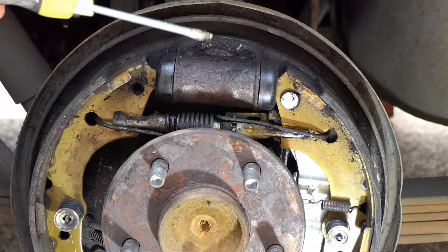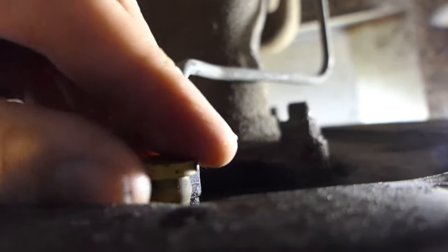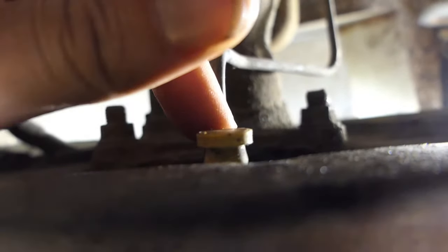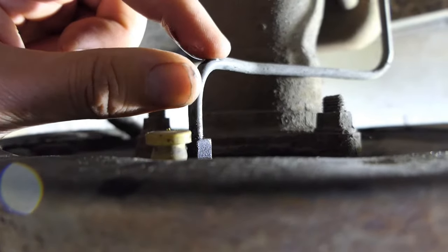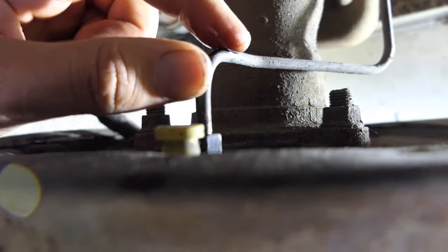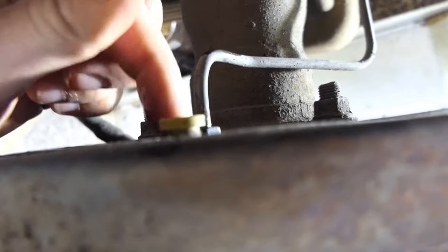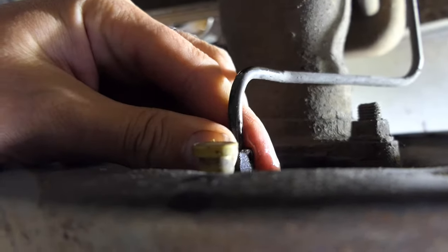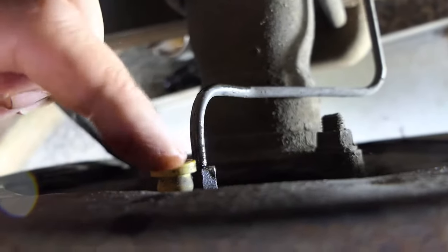Or get a ring spanner and you can cut a slot in it. In the back here, behind the wheel drum, you'll see this cap here is over the bleeder valve, and this line here is your brake fluid coming in. This nut here you've got to undo — just got to be careful, this is a stiff line. When you turn this, you don't want this line to turn because you can snap it quite easily. So you might need to let that soak for a bit. My one has conveniently come undone quite easily with a 10mm spanner. So you need to remove that, remove this, and this will pop off.